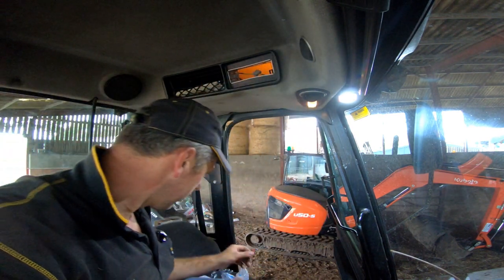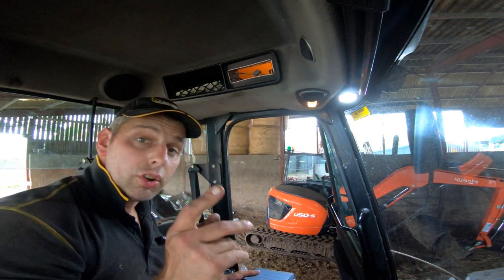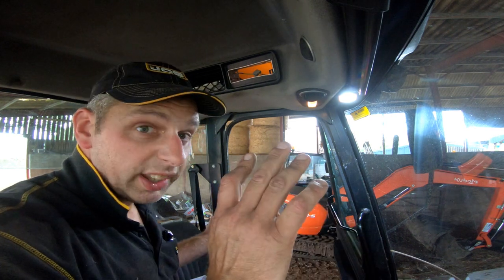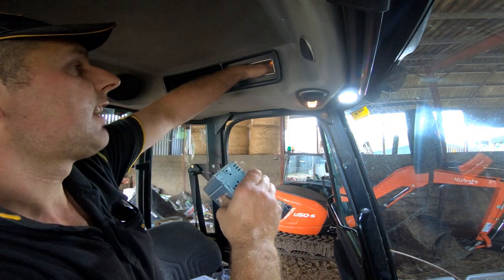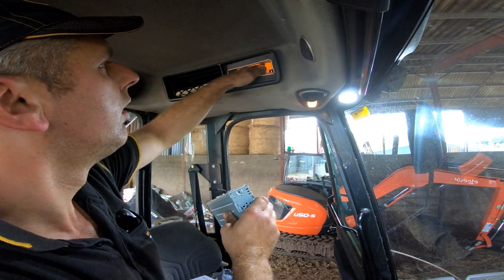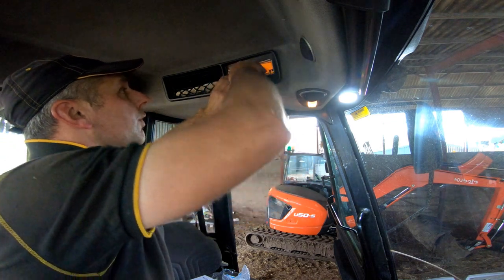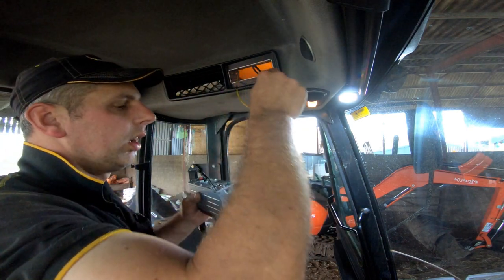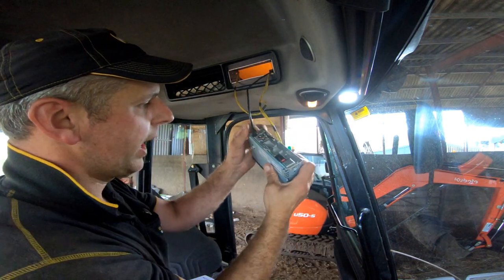So that system I had in the old Andro — that really was super loud, that was a good system. It's something to remember: when you get a DAB radio, you don't tend to get a DAB aerial with them as well. Of course I've not got a DAB aerial, so we're not going to connect the DAB up. But we've still got the standard analog connection for analog radio, which to be fair the signal around here is pretty good. If I want to install a DAB aerial later on, that's no bother. So the analog aerial goes in there.